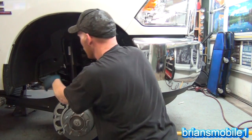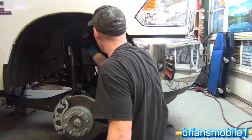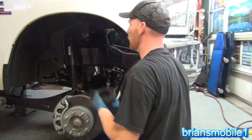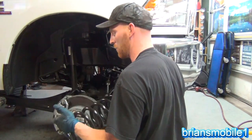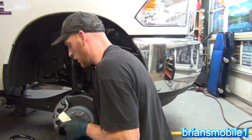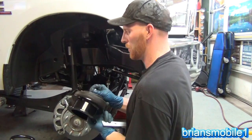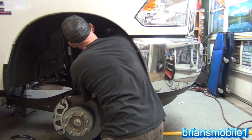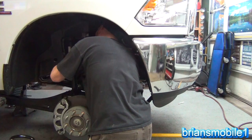I've got the spring out but the bushing's still in there — it has an alignment tab. Some other brands make you cut that off because they're all flat and smooth, but the nice thing about this one is it actually uses it, which helps keep things in order. Because I marked this with a paint pen, it doesn't matter as much that I didn't notice which way I put it down. On this side we take this one with a long bolt. You've got medium-sized bolts, one long bolt, and some longer bolts — the longer ones go on the tabs on that side. Put our bolt up through here, line it up with the mark, stick it in, then take your flag nut and a 14mm socket. The flag nut just holds on its own.